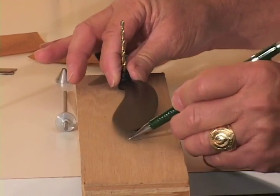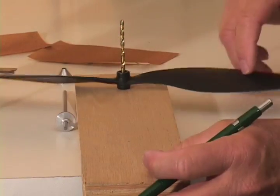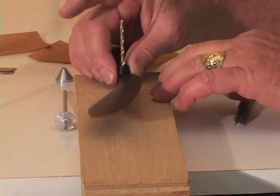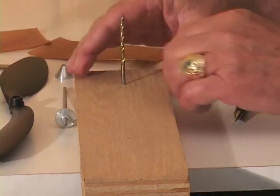What we'll do is slip it on, mark the blade, rotate the prop, and mark it again. Make sure they're both the same length, otherwise you're taking off more material than you need to.